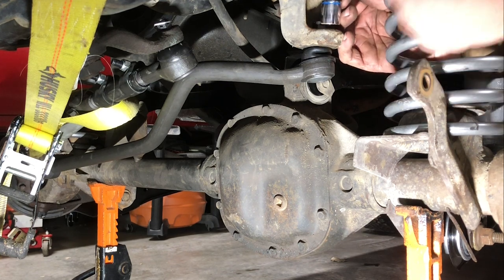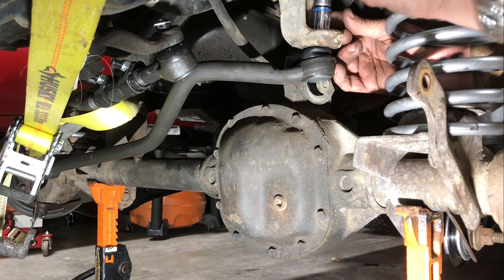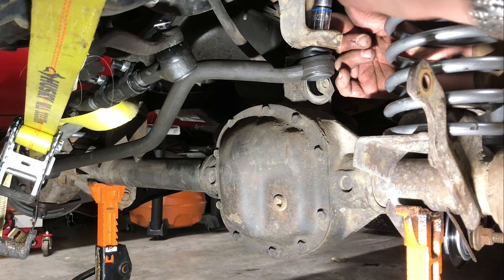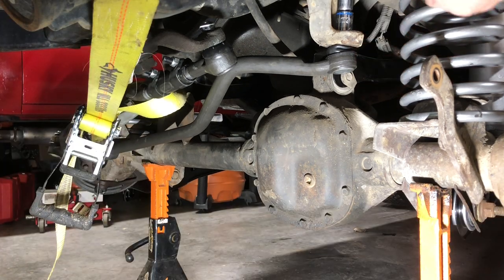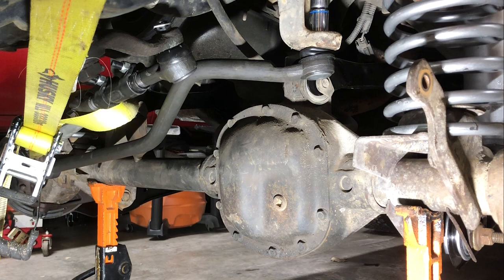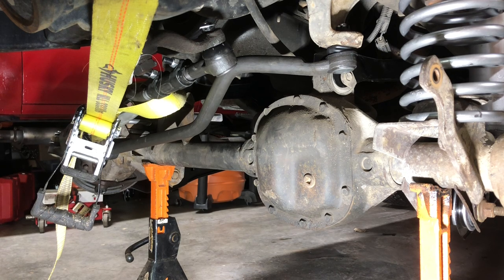Okay, we're coming through there. We've got a ways to go. Throw on this wrench, so all right, getting snug. Now we can torque down both sides of this track bar. Let's see, 155 on this side and 65 up there on the ball stud.